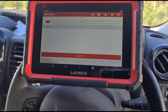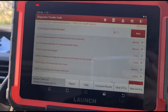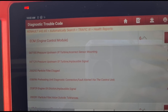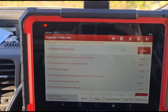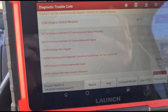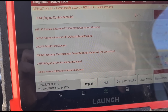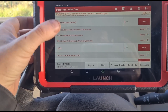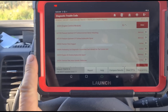We're going to do a health report and go through to see what faults we have. We have a list of faults: P047195 — pressure upstream of the turbine, incorrect mounting. We also have upstream implausible signal, particle filter clogged, preheating diagnostic fault, engine oil dilution, particle filter outside tolerances, and fuel sender circuit open. If that last one were true, it wouldn't be starting, so we'll concentrate on the engine ECU faults.